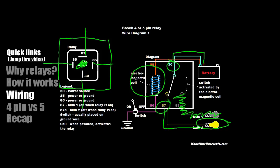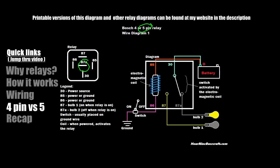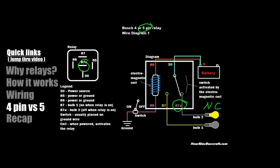This is a four-pin relay — one, two, three, four pins being used, ignoring the middle one. But what about the five-pin relay? A five-pin relay has one extra pin: pin 87a. Pin 87a is referred to as the NC position — normally closed — which means there's a connected path on the inside of the relay in its natural state. So normally closed, or NC, means that circuit and bulb are on by default. You'll sometimes see NC engraved on the bottom of the relay, along with NO.